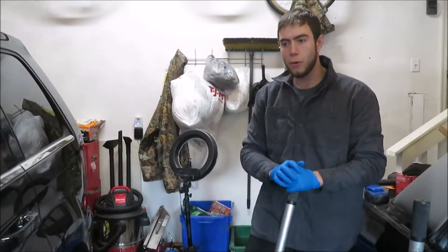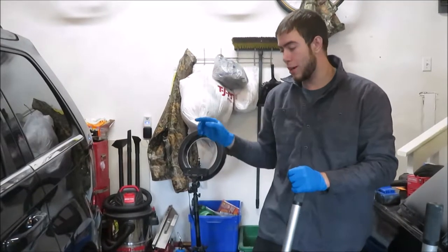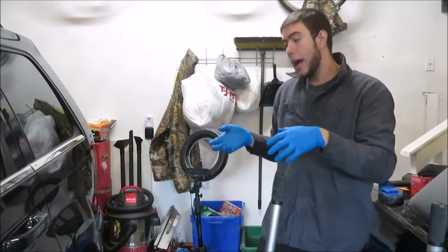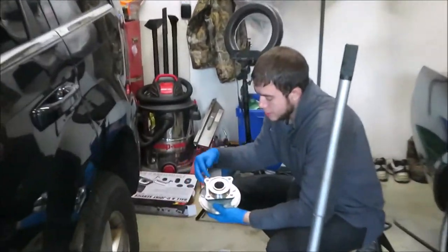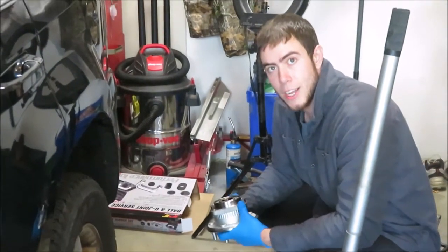It's pretty much simple. I think it's easier in the rear than it is in the front, to be honest with you. But regardless, everything's going to come off — forget your tire, your caliper, your rotor, and then you get to the rear hub. It's held on by four bolts in the back. It's pretty simple. Easier said than done because they're pretty much rusted in there.